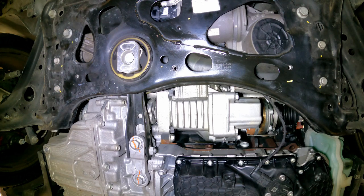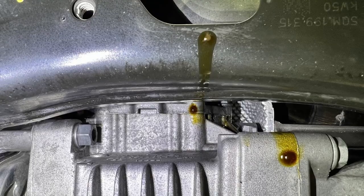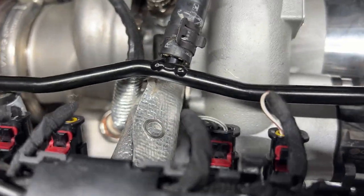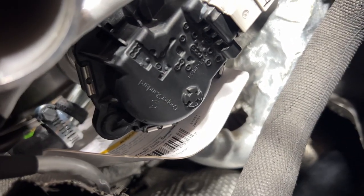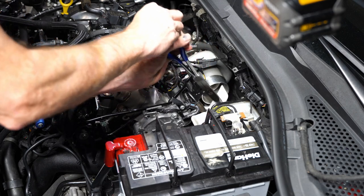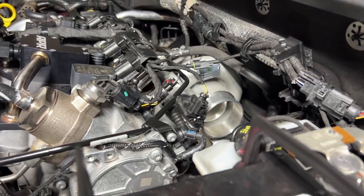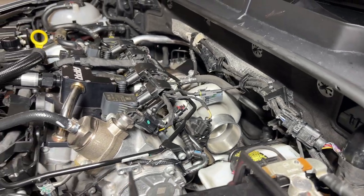I look underneath the vehicle and lo and behold, I do have some oil coming down. I struggled and looked and tried to figure out how to find where it was coming from, but I could not visually see any place that anything was leaking - everything looked solid. It's oil, so I really only have two things to worry about: the oil return pipe and the oil feed pipe. Neither one of them looked like they were leaking. But I shoved a piece of card underneath the return pipe and let it sit there for a second while the engine ran, then pulled it out and could see it had oil on it. The next video I'll talk about how that went down and what I had to do to solve it - it wasn't anything I did wrong with the install; it was one of the components giving me grief.